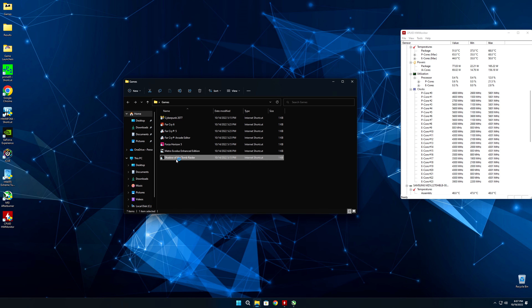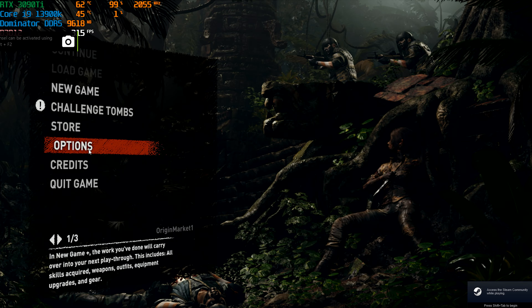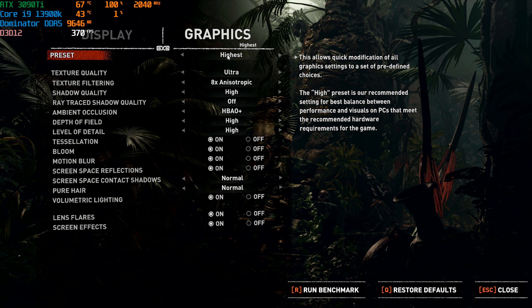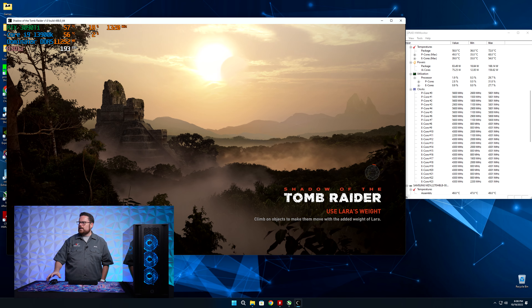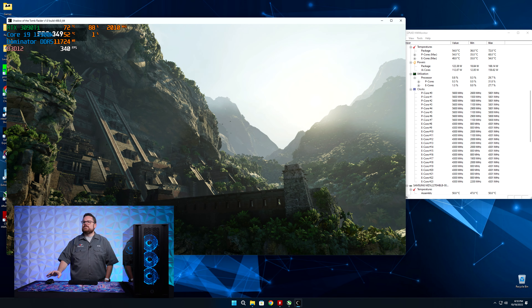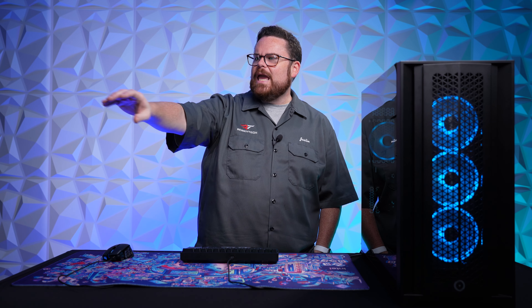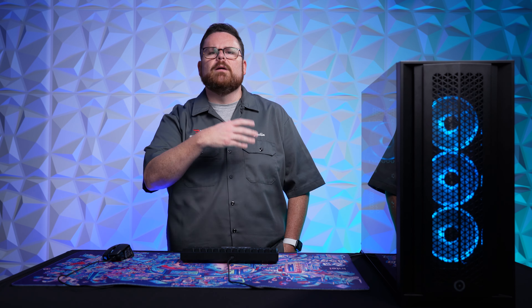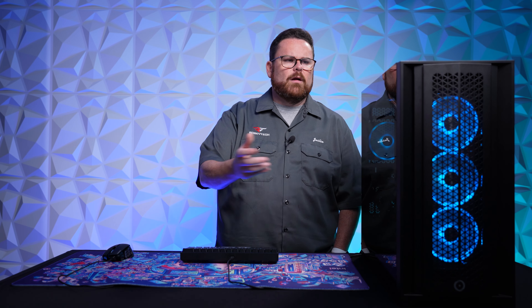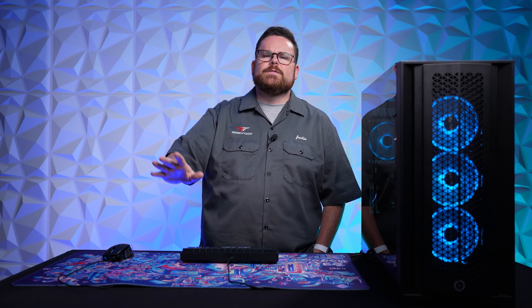Another game — I'll run it at 1080p. Let's go to Options, Display and Graphics. Just verifying we're DX12, DLSS is off, graphics set to the highest. We're going to run our benchmark. Our overclock is still enabled. We've seen 5.8 on all cores at one point. The highest temp we ever got was 72°C, and that's not from gaming — it's from using Windows and applications, which any 360mm AIO cooler would be completely fine with. Leaving your overclock set is absolutely fine.